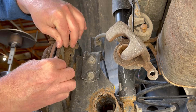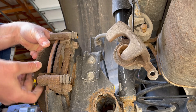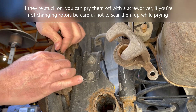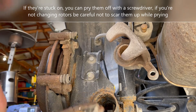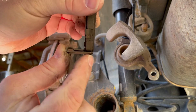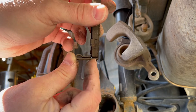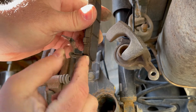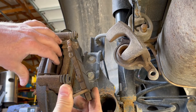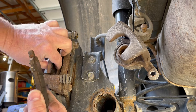Now I'm going to get a look at the brake pads and take them off. You can see mine were pretty worn out. This little tab on the bottom of the brake pad is actually supposed to stick out a little bit past the back of the backing plate. When it starts to rub — when you start hearing squeaking when you're braking — that's what you're hearing: this little wear indicator rubbing on the rotor just to warn you that your pad is almost gone. And if you can catch it and change it before the actual pad is totally gone, you might be able to get away with not having to replace your rotors. If you wait until you're actually grinding, you're probably going to need new rotors because it's going to scratch and tear them up pretty bad.